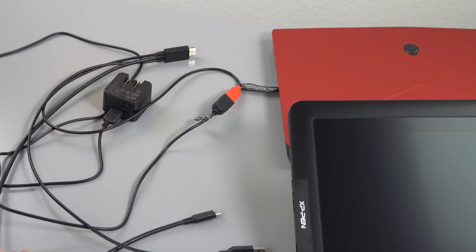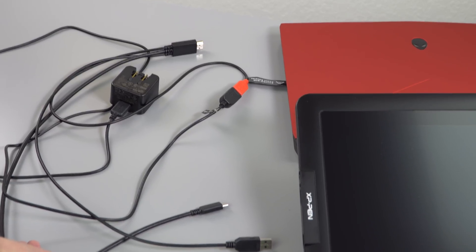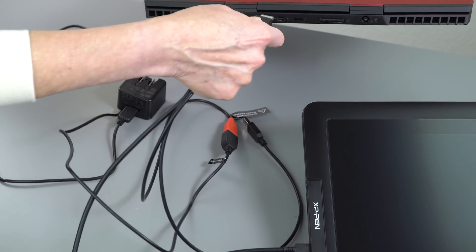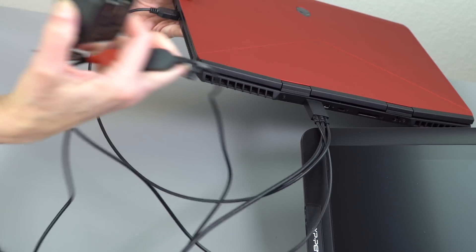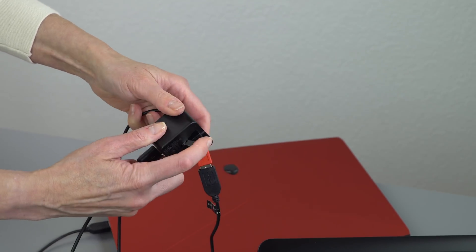Sort of like what Wacom has been doing with their single cable solution — it's not really fully single, not USB-C to USB-C — but it's a three-in-one cable. There's one single connection on the back of the monitor. The three-in-one cable works a little bit oddly: the pigtail connector with three wires comes from the HDMI connector you plug into your laptop or PC, from which you also have a USB-A cable for the PC and another USB-A-looking connector in red marked 'plug-in charger.' The USB-C termination then plugs into the tablet. I did test a straight-through USB-C cable with our Alienware M15 and another laptop and it didn't work — it seems to need that charging brick cable connected.